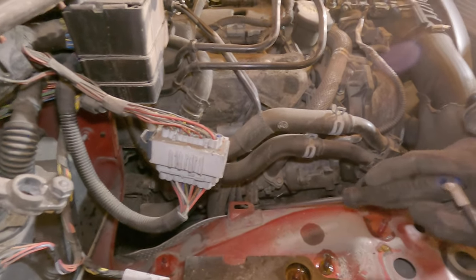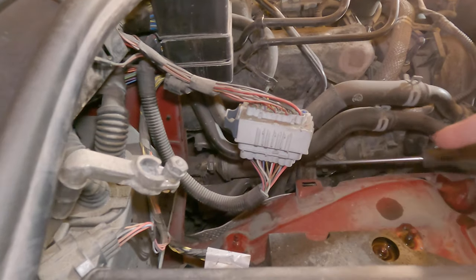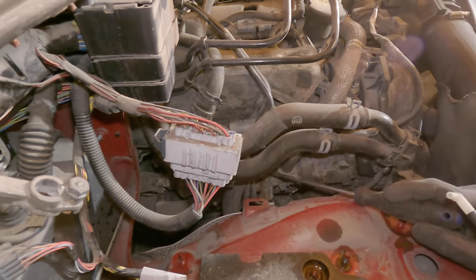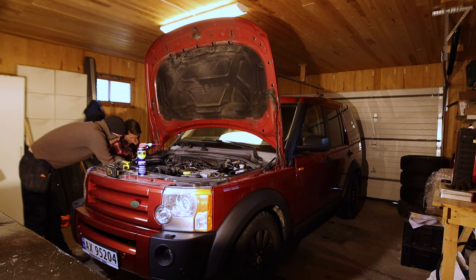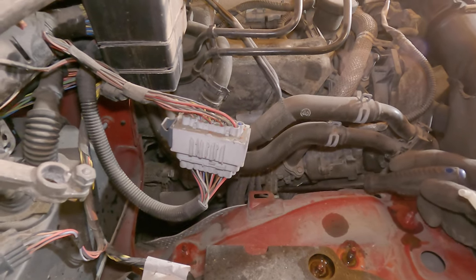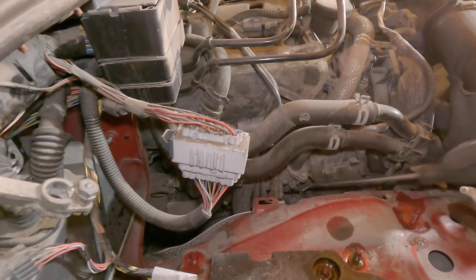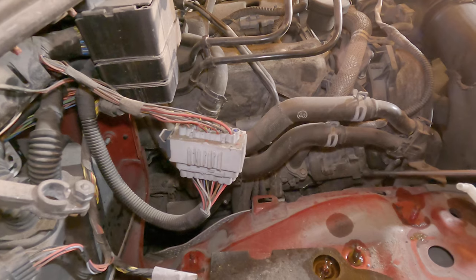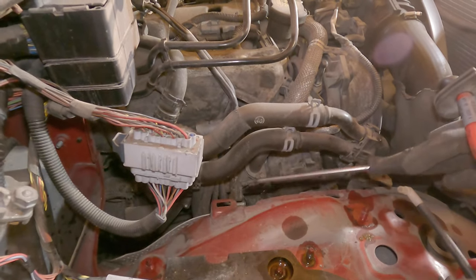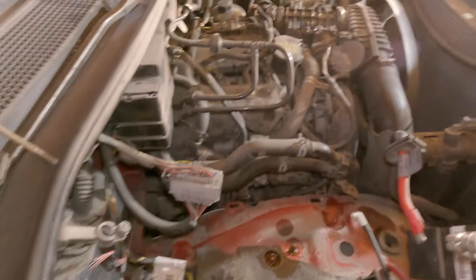They usually loosen the clip on the cooler, so we can move the cooler. Okay, so we're going to take everything just loose, before we do the inner one. It's a long time ago. On some of the early cars, the screw is from the front side and not from the back. I've read that one is really difficult to get to. It really depends. First we're going to take the pipe, then we can have a look inside. And we're going to take the connector, which is here. Probably do both sides, then start disassembling on one side and finish that side before we continue.